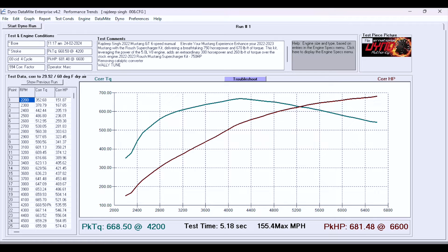We've just made our first set of adjustments. Wally's in the car — he saw what was wrong, uploaded a lot of changes, made some fueling adjustments, and we're already 30 horsepower over the advertised wheel horsepower from where we were. We went from 555 to 681 in about 20 minutes. Now Wally's got all the hard work ahead of him — the uphill battle to make little bits and bigger changes — but we're already at 780 horsepower at the crank.